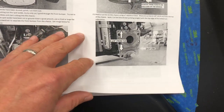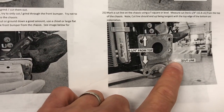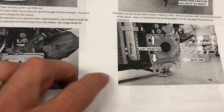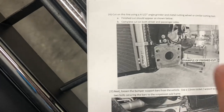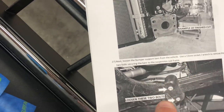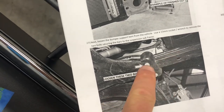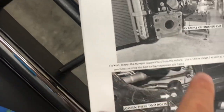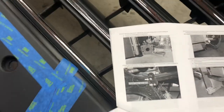The next major issue I ran into was step 25, where you actually have to cut. You mark a line six and a quarter inches from the top across — that's step 25 — then step 26 shows it already cut. Step 27 shows you removing two bolts from a bumper support brace, but right there there's a piece of metal attached in front of it that has to be taken off first. They don't show you removing that at all until after they show you marking and cutting, so do not cut that piece — it goes back on to help support your bumper.